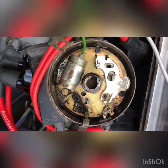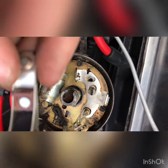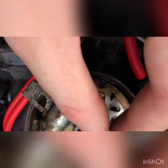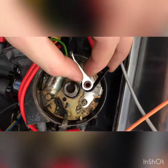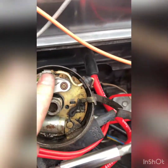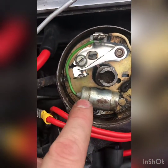I had a bit of trouble getting them in. I took the little point bit out first - there's the little terminal bit - then I put the main body in. What I'm going to do is bend this around, put the spring under a bit of tension, and then put it in. I've just put the points in and connected up those two wires there - you've got your earth wire and then you tie it up to your condenser.